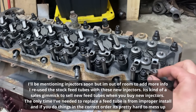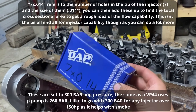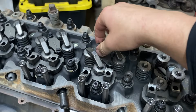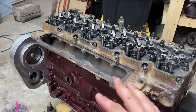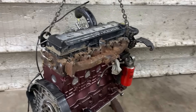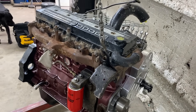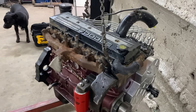Moving ahead, we've got some 7/16ths pushrods and some 7x14 diesel Autopower SAC-tipped injectors for this build. Currently I'm putting the valve bridges on, the injector hold-downs, and the injectors are in. The valve train is all coming together. I don't have a valve cover yet so I've got to go pick one of those up. I've got the engine in rough mock right now — there are parts that aren't really meant to be there, such as a 12-valve exhaust manifold. This is really just to seal it all up and pressure wash everything so there's no oil on it, as it's easier to pressure wash it all together than each part individually.